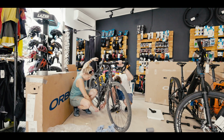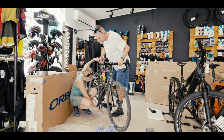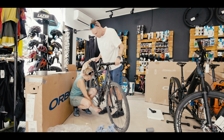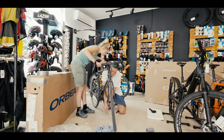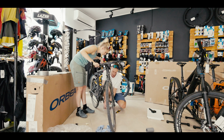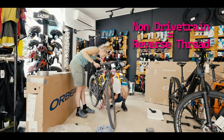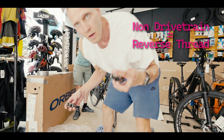So pedals always need to come off. When checking in the bikes, the airline person typically asks if the pedals are off and if the tires are deflated. Taking off the pedals is the most tricky part of this entire operation. The pedal on the non-drivetrain side is reverse threaded. That means in order to loosen the pedal, the bolt needs to be turned clockwise. Pedals off.